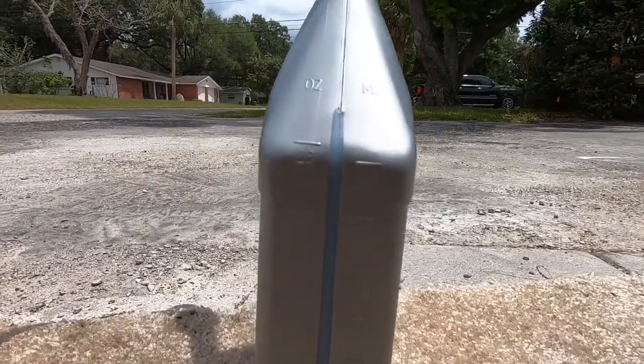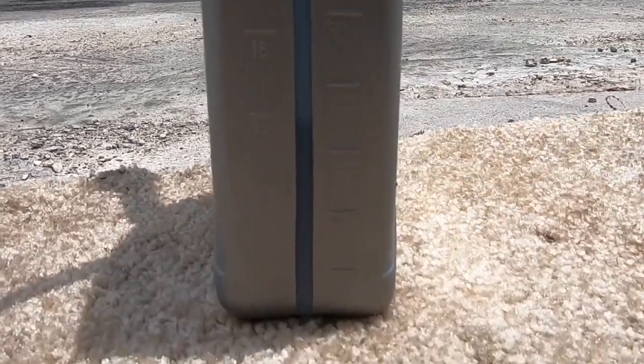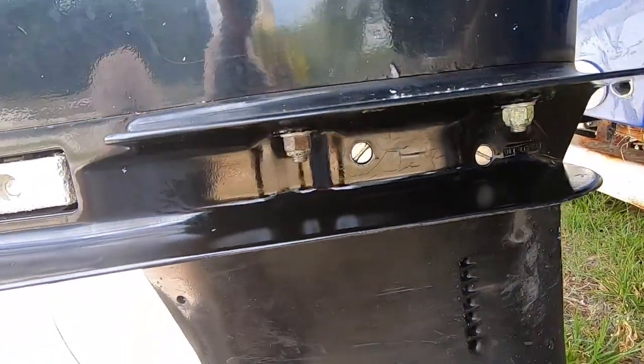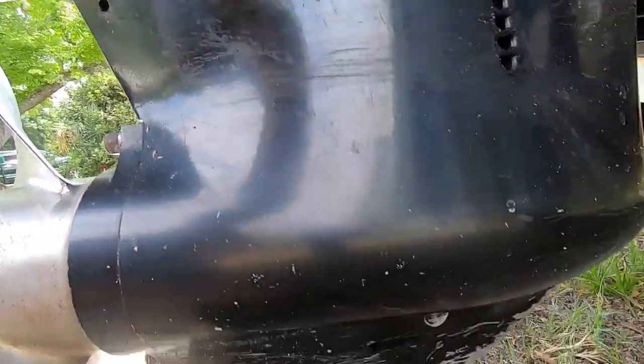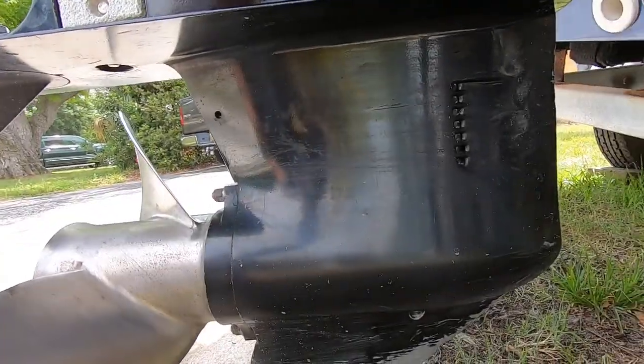This shows you how much gear oil we put in there — it's not a full quart but a little bit more than a half a quart. We got the drain plugs back in, everything's good. We're going to keep an eye on it to make sure there's nothing coming out of the drain plug. Hopefully that fixed the problem. You can also tell by the color — this oil looks a bluish color, and what came out of there was a milkshake.